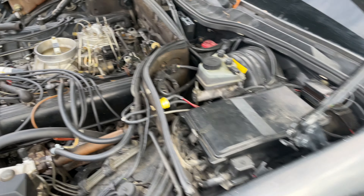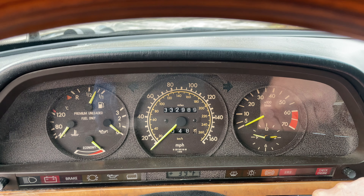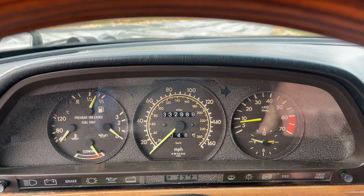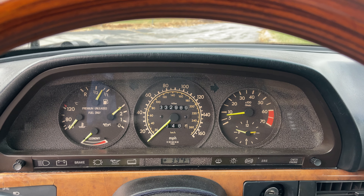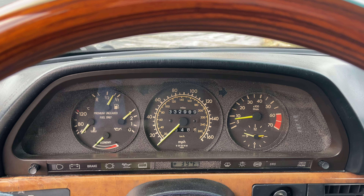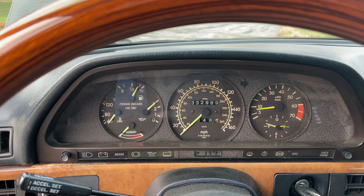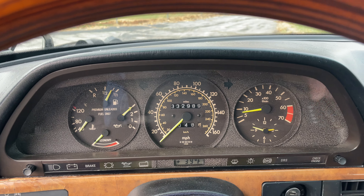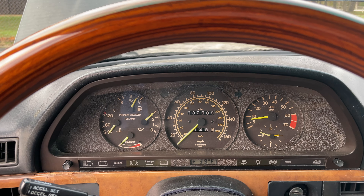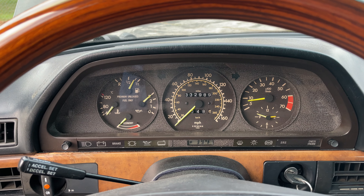Let's see if we can turn this on and see what it actually looks like, and then we'll know if the 1-amp setting is too low for my car or just right. The car hasn't been started in two days. So we're right there where we're supposed to be. And that's it. You can set it to where I had it before — a little bit below, I'd say about half a millimeter below — so it might be 1.1 or 1.2 amps — or you can leave it at the position we adjusted two days ago in the other video, basically at 1 amp, fully closed.